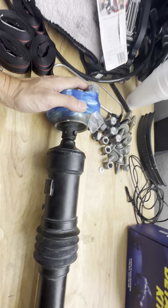This is an incredibly common problem amongst Jeeps and older Land Rovers that had high lifts and short driveshafts. You can see that it would tweak both of these pretty far and that'll blow up. These shafts right here are pretty narrow. It does have a slip yoke and a plunger mechanism that helps push it back, because if that gets moved back and forth it could damage things further and spit those bearings out. You can see the balance weights here.